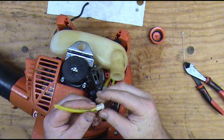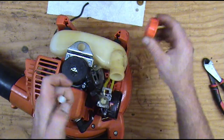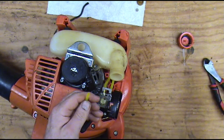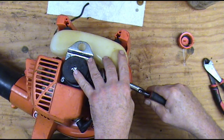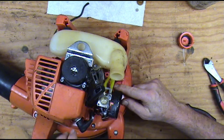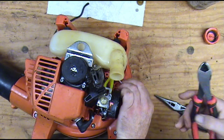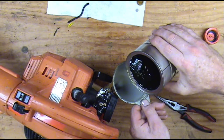This blower has a vent that comes up out of a line — that's how the tank breathes. Sometimes you'll have a little vent in the gas cap; this blower has a vent on the end of this line. We just want to push this line just down inside the grommet — you don't want to push it in very far, or the fuel tank will push fuel back up this vent. Put a little WD-40 on there and push that vent right down in the tank. This blower has a little notch for this vent to sit in. We're going to put a zip tie around these lines to help hold the vent — the factory doesn't do that, but it just looks a little neater.